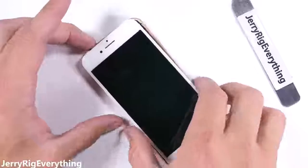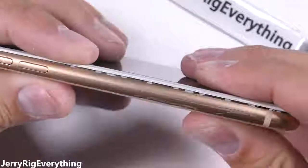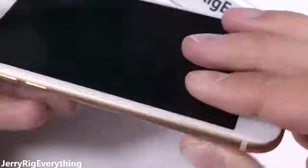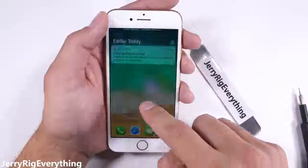After all the screws are back into place, the phone folds shut like a book, and the top of the screen lines up with the metal frame first. And then the sides clamp in all the way down to the base of the phone, which clamps in last, and has the bottom 2 screws. And everything works. I'm kind of surprised myself.